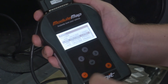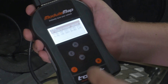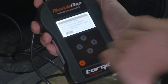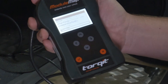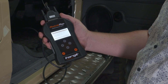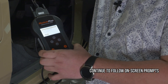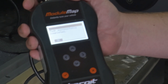So we've got Land Cruiser 70 series selected. We'll then select the 4.5 litre V8, which is what this vehicle has. It will also prompt you through this main menu to switch on the dashboard, check the connections, and press OK to continue. So we press OK. The module map is now completing its read of the vehicle. It's now prompting to switch off the dashboard to continue. It says task successfully completed, so we're good to go.